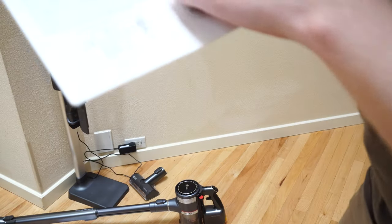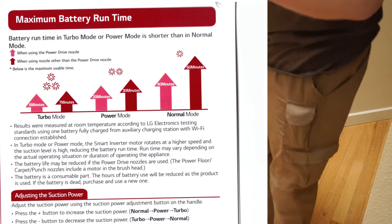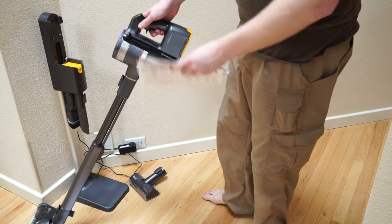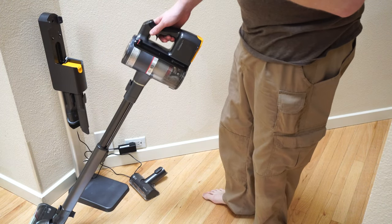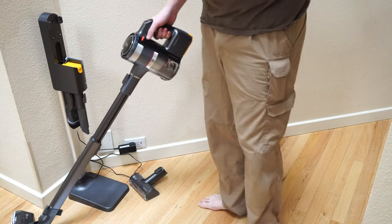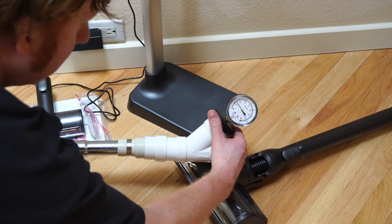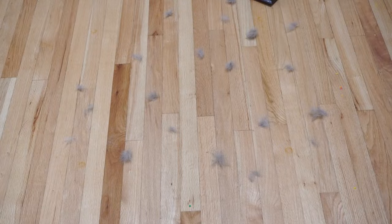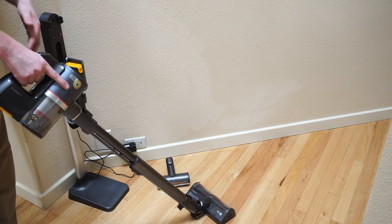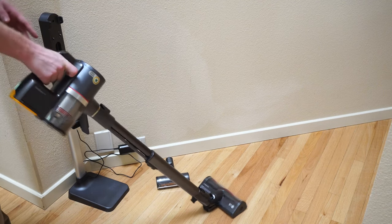Looking right here, it says runtime with the brush: seven minutes, but I was getting about 10 to 12 minutes, so times may vary depending on your particular unit. I never once ran this for 60 or 80 minutes as advertised — it's a stick vacuum, its main purpose is for quick pickups. It might be capable of 80 minutes, but as tested with the working vacuum gauge, it doesn't have enough power to pick up off the floor on the two lower settings. I'd describe the power settings as a low, a medium-low, and then an extra high.